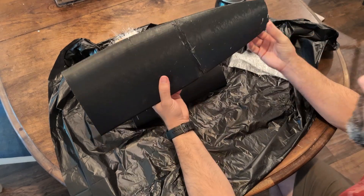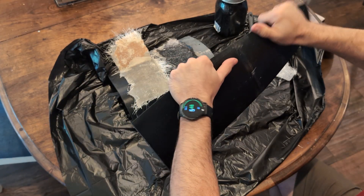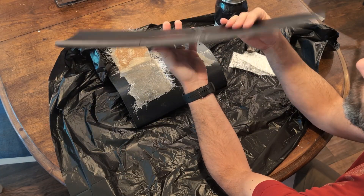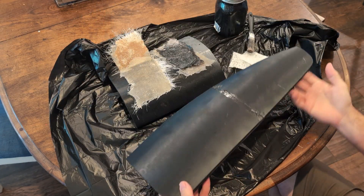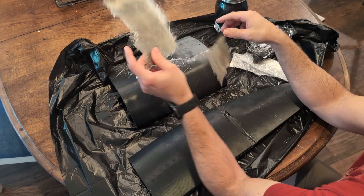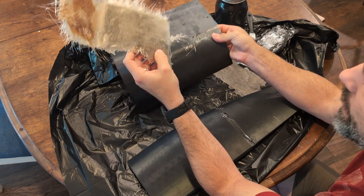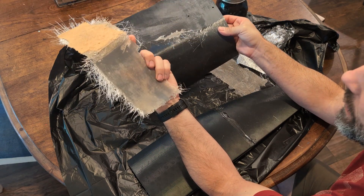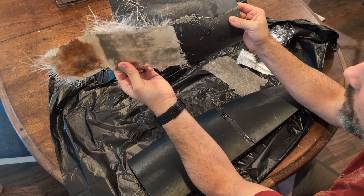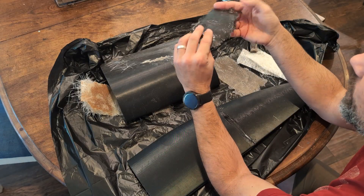About 24 hours later — this is our project piece and it's already a very strong bond. My original plan was to fiberglass it with resin — I was using polyester resin, epoxy may work better, but I don't think it would have. I tried roughing the surface with 50-grit, tried with and without primer, and all of them would peel up pretty easily. For a whole car that's going to flex a little bit, I did not trust it.